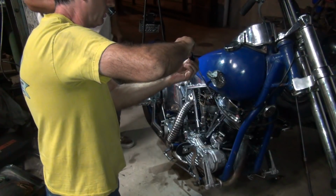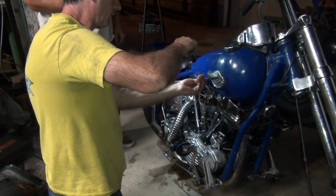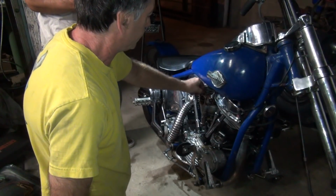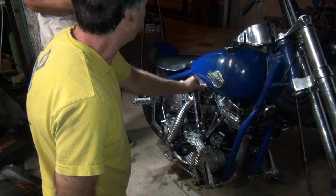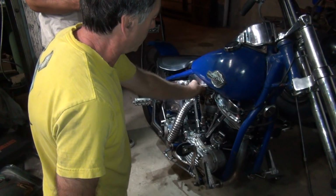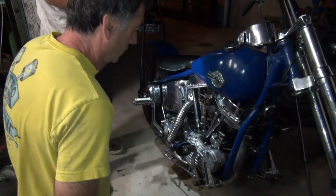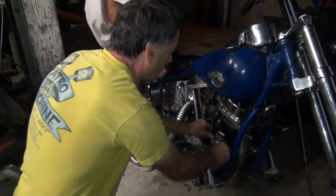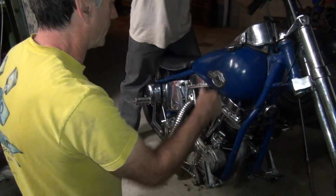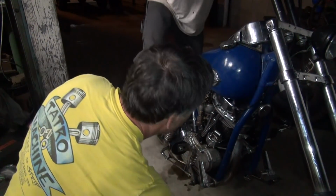Okay, so slightly hot. Half, 1, 1.5, 2, 2.5, 3, 3.5, 4, 4.5 for you. You notice how it's not running nearly as good as it was when we first started it? Yeah. It's because you're running out of gas. That happens. Start choke at 1/4 inch. Carburetor should be full, I hope. That petcock is on reserve, right? Yes. Okay, 2 kicks. 1, 2.